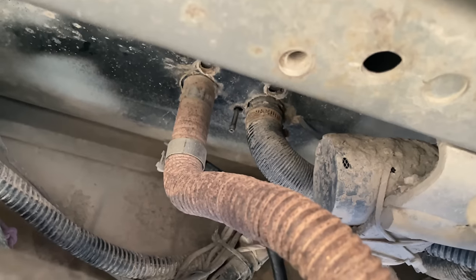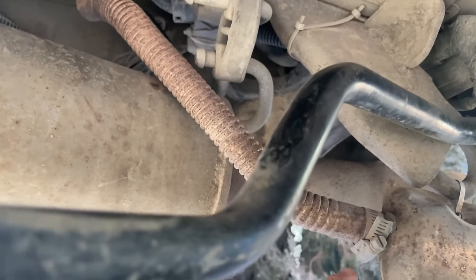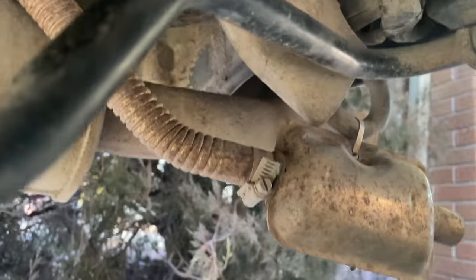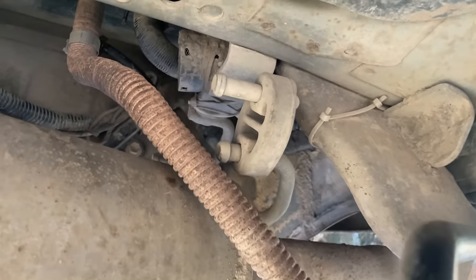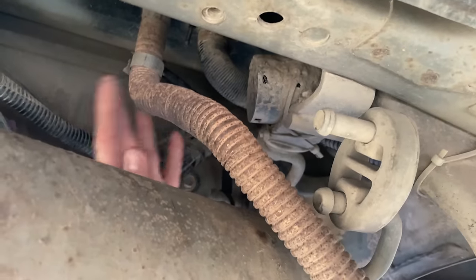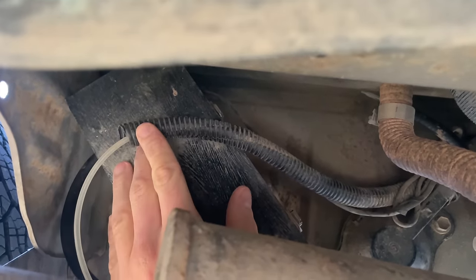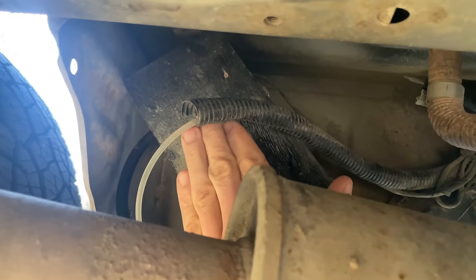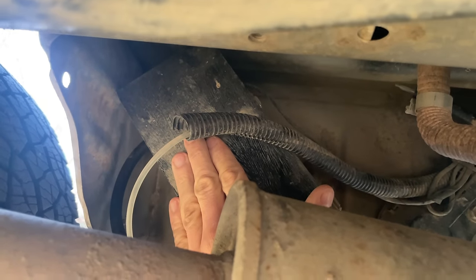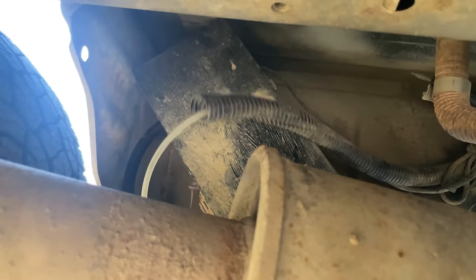And then with routing the exhaust, you just want to make sure there aren't any low points where water can accumulate. Like I said before, the weep hole for the muffler is at the bottom, and the exhaust shouldn't be close to anything flammable, because especially up here the exhaust can get red hot. And then my fuel pump is just in this box. That's the silencer box that I explain in another video, but it's also worth mentioning that the pump shouldn't just be exposed to the elements. The electrical connector is not waterproof, so you need to at least protect that from spray somewhat.